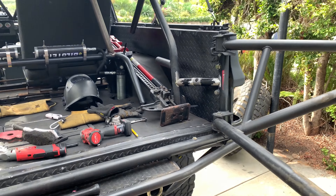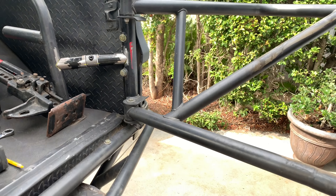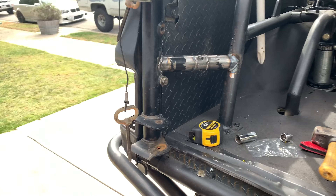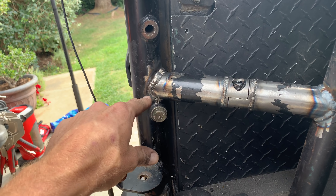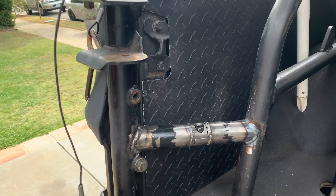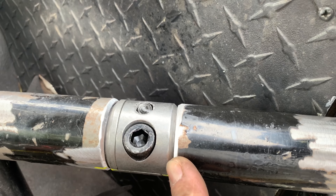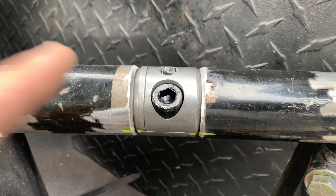I'm connecting off the cage to this upright for the rear gate tire carrier. This was simply bolted on before right to the body, so I was getting a lot of movement out of it. This one's already been burned in and it's come out good — it's still removable, much like the cross tower I can remove. So should I need to change this out, I can pop it out still. Spend your time on the details, getting all the prep work done — I'll have a nice groove to fill as opposed to something garbage, and then all this is going to get cleaned up.